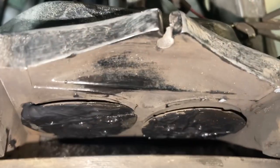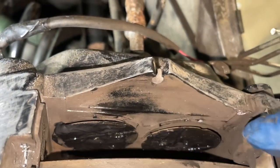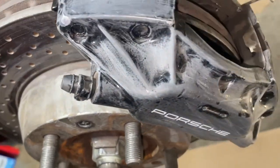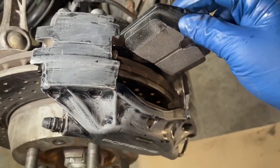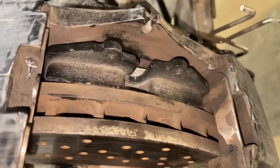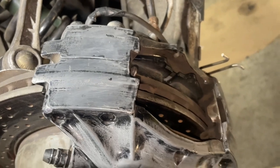I've got the light on now — you can see I put those dampers in there. I did get a little grease on that side, which is fine, I just didn't get it on the brake rotor. I'm going to slide the pads in. I just cleaned these pads. The pads go in like this. And that's it — that's a new set of pads in there. Those will stick really nice. Hopefully no squeaking.